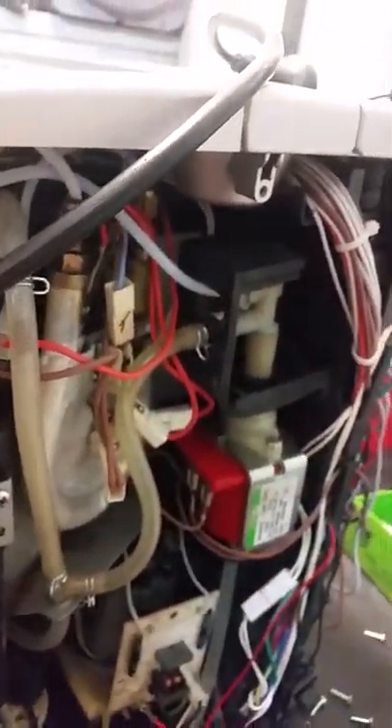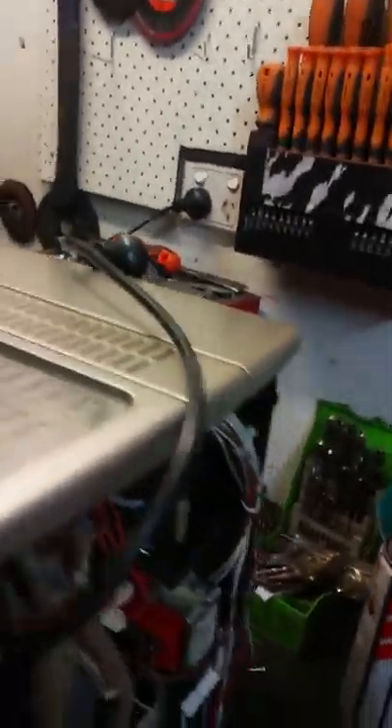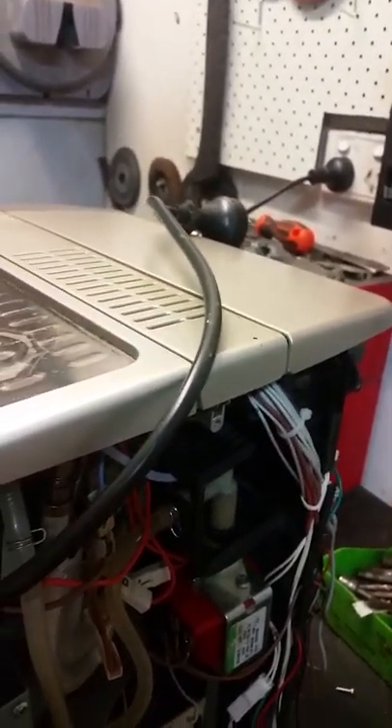Little O-rings can fall out, so take your time and relax with it. Before you stick your fingers in there, always unplug the machine — you're mucking around with water and if you're also near the pump and electricity, you've got to be super careful. And there you go — that's my quick Magnifica 3500 run-through of the problems and the fix.